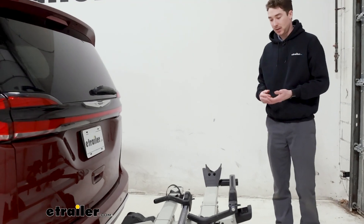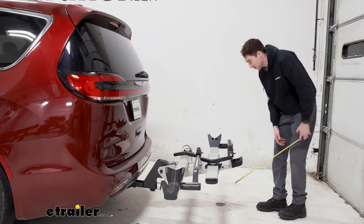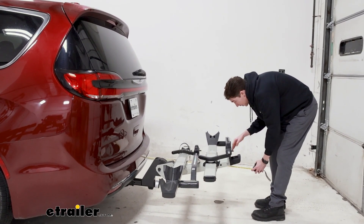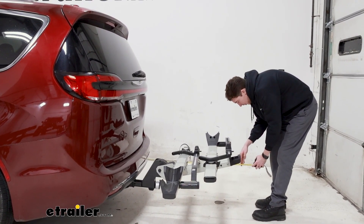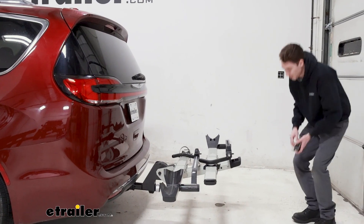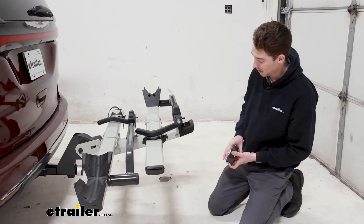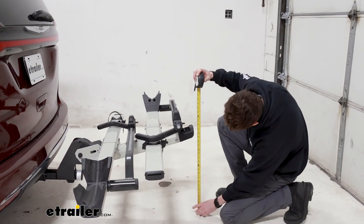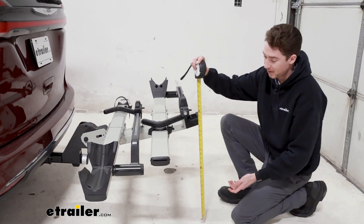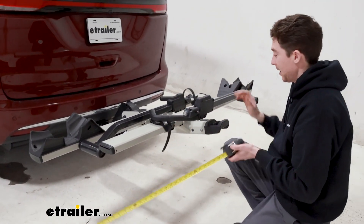With everything out of the way, we can get a couple of measurements so we can see what it's like to live with it on this car. With the rack fully folded out, from the bumper to the furthest point in the back, you're looking at about 35.5 inches, so it does stick out quite a ways. There's a pretty significant rise with the stadium-style design, so the front tray is even further down than the back tray. Ground clearance from the farthest end comes in about 18.5 inches, and to get your highest bike up here it's about 21.5 inches.